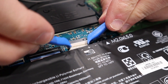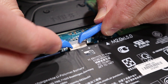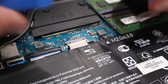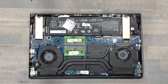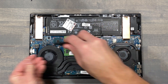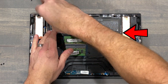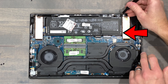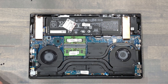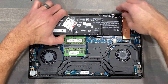Before we can reinstall the bottom panel, the battery must be plugged in. There's very little room here and I do not feel comfortable forcing this connection at an angle for fear of bending pins. I recommend partly removing the battery to gain a better advantage. There are five screws that hold it in place — I'll remove four, leaving the fifth, which is located under the M.2 drive. Once you remove those four screws, you'll be able to lift the battery up enough for a proper plug angle.